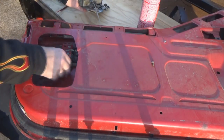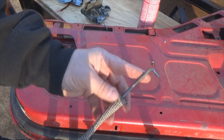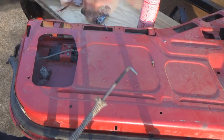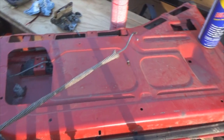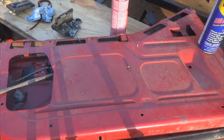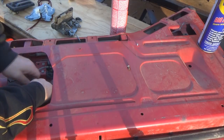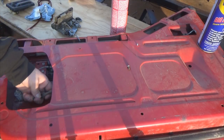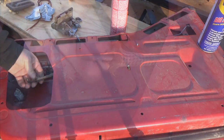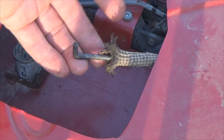Now the long rod that ran up through here that I pulled out all in one time - I've already stuck it in there. What you want to do is feed it back in. You see the hook here where it kind of kicks up at an angle - that's going to be facing upward down here. Feed it back in and feed it back under. See how the bend is kicking upward? That's where your inside door handle is going to hook that - you pull it and it opens the door. Notice this is also pointing upward because you've got to get to the latch with it.